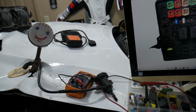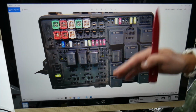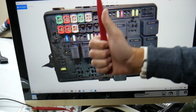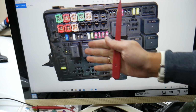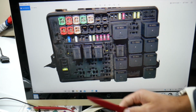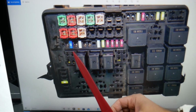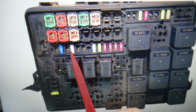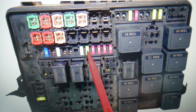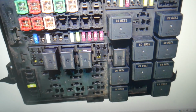Please check it out. So guys, for the canister valve, which fuses do we need to check? Actually, there is very limited information about that. That's why we need to check our engine management fuses and relays. There will be quite a few of those, but most likely the function is integrated in one of those for the canister valve. If you come, that's 1, 2, 3, that third row of fuses. Here you need to check fuse 31, that fuse right here. You need to check fuses 34, 35, 37, and relay 63, which is known as the ASD relay.